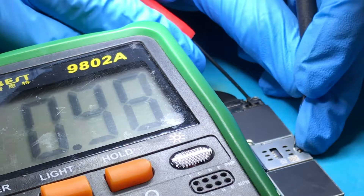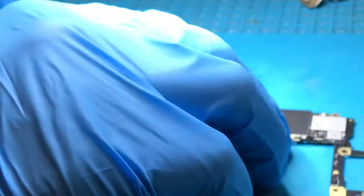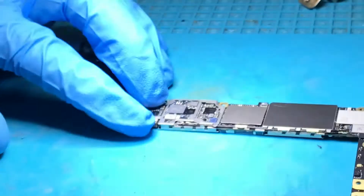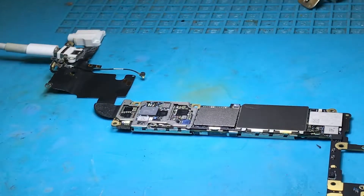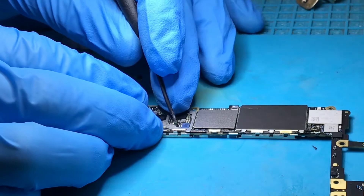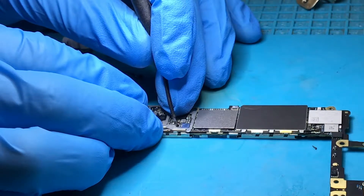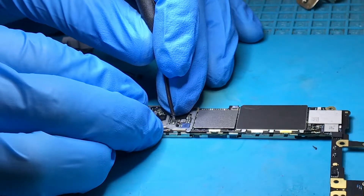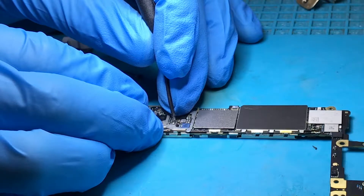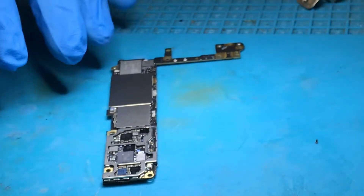As you can see, 3.7 — that's good. Then it drops down to next to nothing. So that shows we have a faulty IC there. I'm going to check the voltage coming out of a couple of lines here. That's the 1.8V line and that line drops from 1.78 to 0.6 — obviously bad. This line is the 3V line, which is 2.97 and drops to nothing. There's obviously something going wrong here. I'll be totally honest, I'm not entirely sure if this one's going to be TriStar or Tigris — could be either.